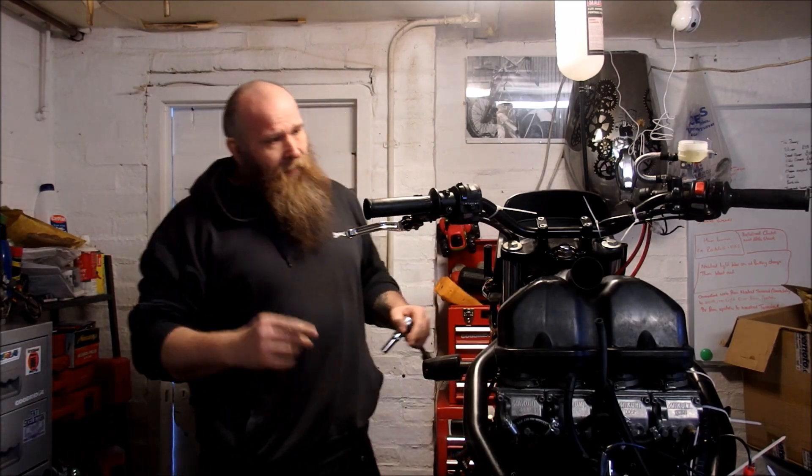What we're looking at here is the pot — there are two pots on either side. I've reverse bled the brakes but the rear pot is slightly further back or recessed than the front. When I push, you can see the pressure building up. I can see it moving but I'm trying to get the pressure to push it out — she's moving but let's keep going for a couple of minutes and see.